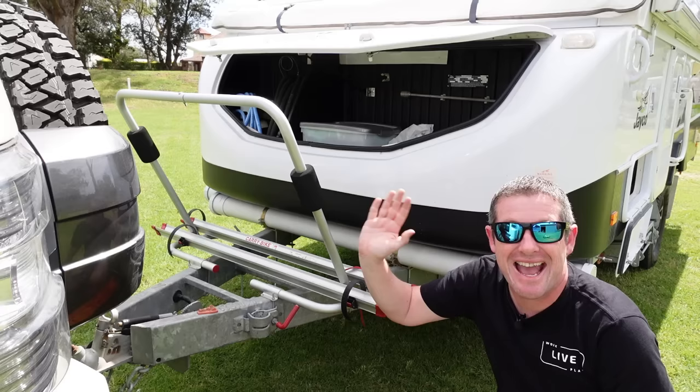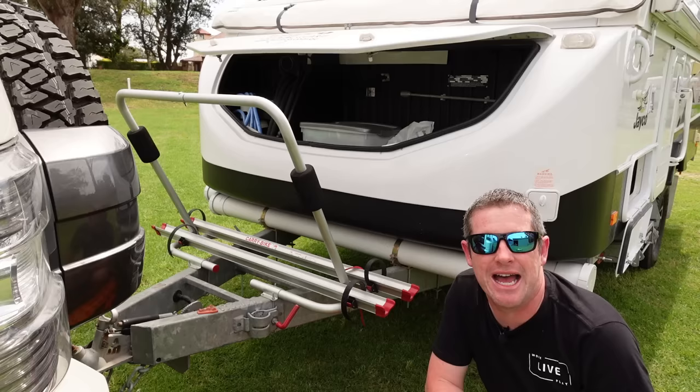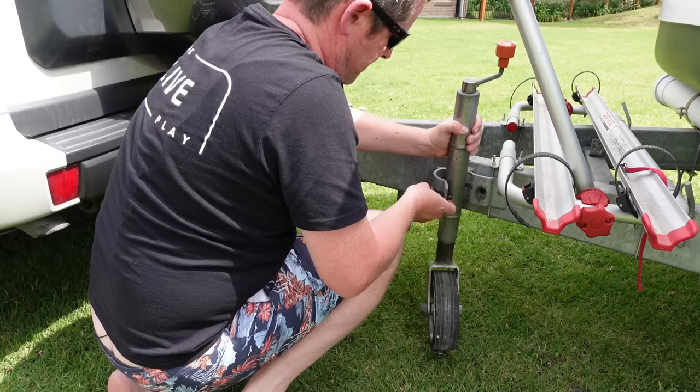With the bikes out of the way, we can open up the boot and side hatch and get access to all your gear. Hopefully you're on a nice level site so the van can stay where it is — simply put your wheel chocks under one of the wheels, pull up the handbrake and you're ready to unhitch. But quite often you're not, so at this point I would reverse up onto your levelling strips, get the van as level as you can while it's still connected to the vehicle, then go through the unhitching process.